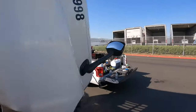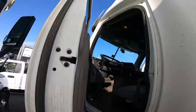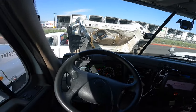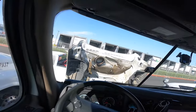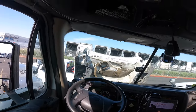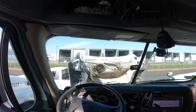Let me show you guys with this one on the inside. So you chalk your wheels just so it doesn't move. Turn on your truck, let it build up the air all the way till it purges. Let me speed it up for you guys.